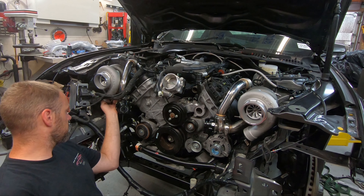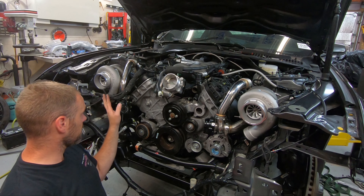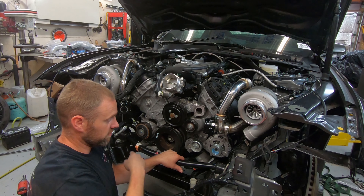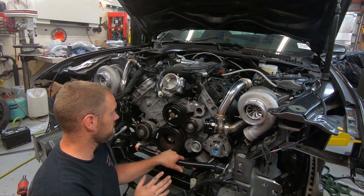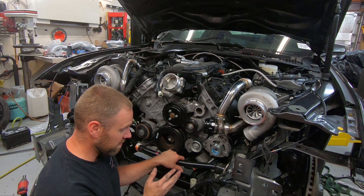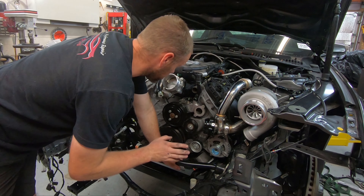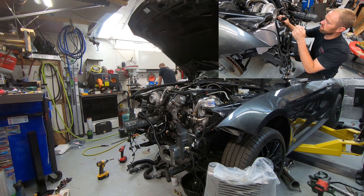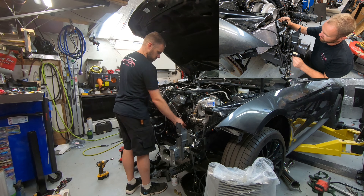This turbo is missing one of the bolts. I don't have anything tightened down because I don't know where it's going to need to be indexed yet. I have to index the center carrier for the oil and the drain. The drain for the oil — I'm not even sure how that's going to hook up yet. I probably should have thought about that before I put the engine in. That may bite me later, but I'll see.